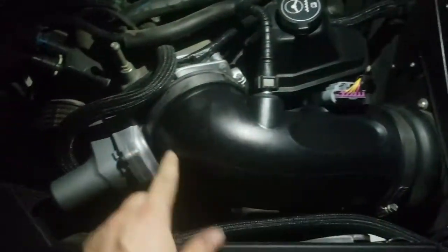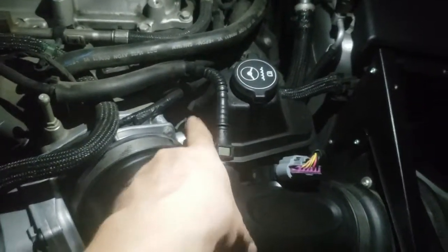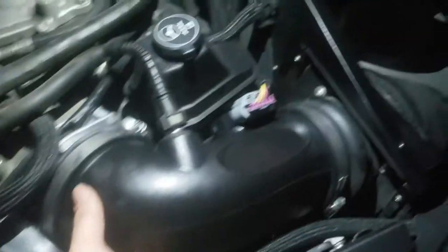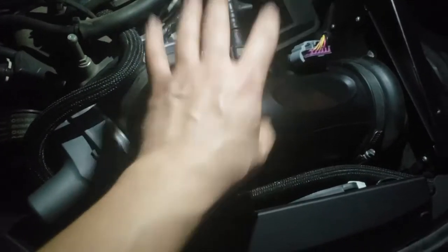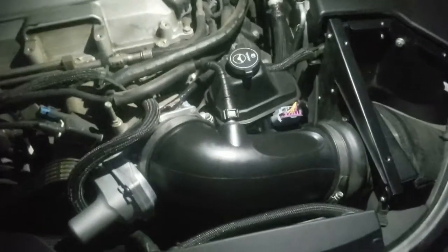As you can see I got my intake tube back in. These two connectors fit the exact same — the only connector we had to modify was the throttle body connector to stretch it over. Remember to zip tie that out so it does not hit the supercharger belt. Also my worm clamp for the intake tube was on the other side, but I flipped it over because there's a pretty tight gap right there. I pulled the coupler off the throttle body and put it on the actual intake tube. Everything is tightened down, connectors reconnected — just gotta reconnect the battery, put the air box lid back on, and we're done. Thanks for watching, please smash that like button if you found any of this useful, and I'll see you in the next video.